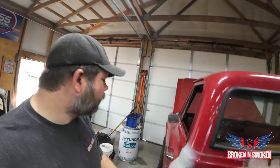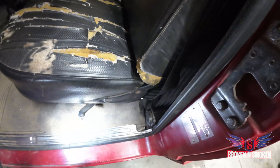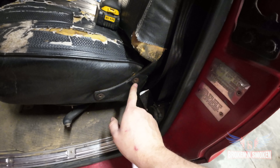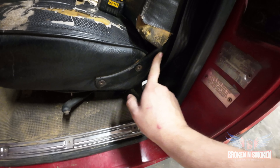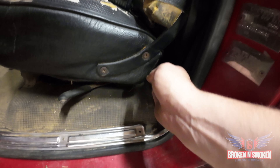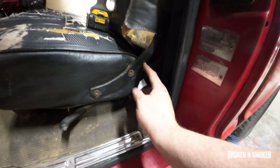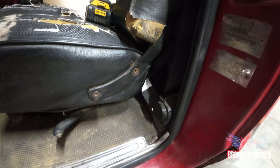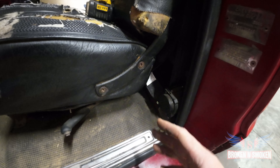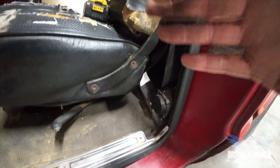Let me show you what I've got going on. I hope you can see a little bit, because I've got the door shut because of the wind. But a dead giveaway this one doesn't fold forward is this piece — it's got a permanent arm bracket. The ones that do adjust have another piece hanging right about here that's attached to the frame somehow, and it's got a bolt welded to another piece up here that goes down in the hole. Believe it or not, it has a wing nut from the factory that keeps it from moving forward. A lot of times people remove those wing nuts because it is aggravating to come over here and unscrew a wing nut just to move the seat forward.